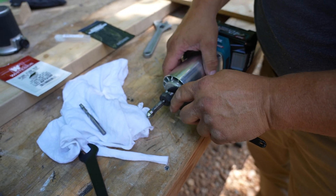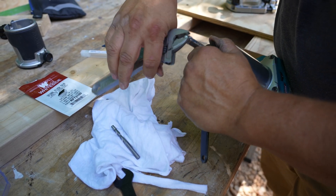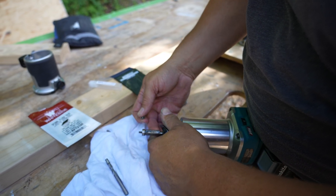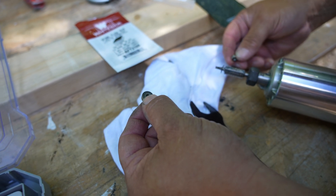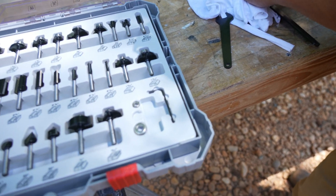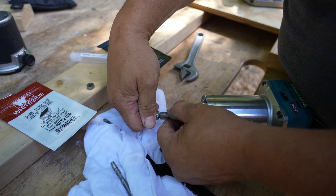Let's go ahead and change that bearing out. A little overkill here — I should have grabbed a nut driver. That nylock is a little loose right there. One of the reasons why this bearing possibly wore out — you can see how loose it is. Look at the movement. The nylock came loose. Hopefully this bearing from the set will fit. Oh yeah — so we can identify what bearing that is and replace it. We got one in the set.